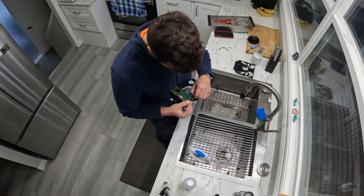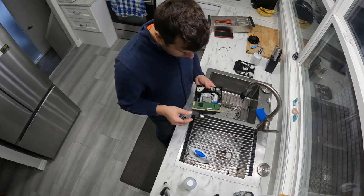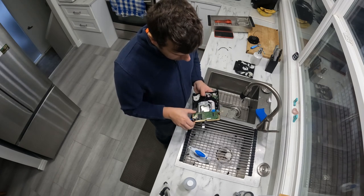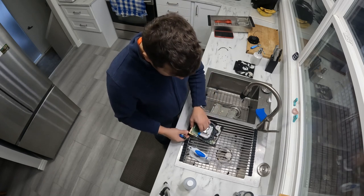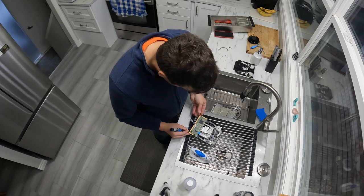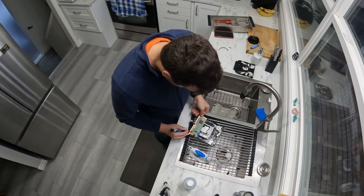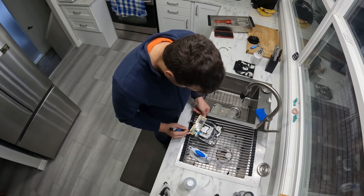Now I'm disconnecting the daughter board from the bottom half of that drive there, pulling out the worm gear motor ribbon cable, and also taking out the motor ribbon cable that spins up the disc, and also the switch position sensor / gear feed.